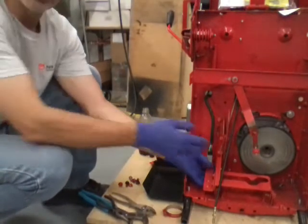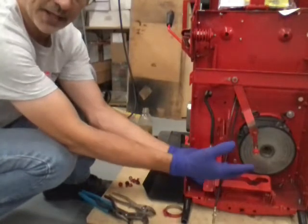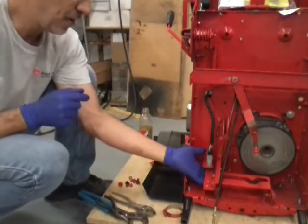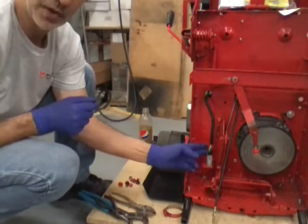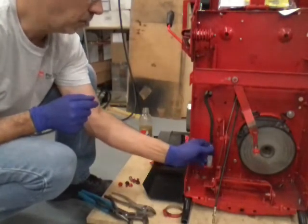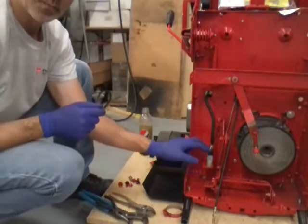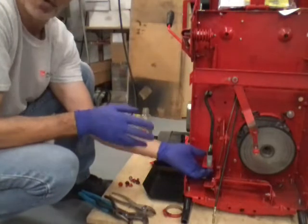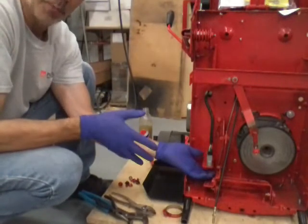This is your yoke. When you push your clutch in, this comes up and pulls the chain case away from the drive disc. If you push it up hard enough it applies the brake. This little gray thing is a safety switch, and when you're letting out your clutch it opens the switch up. This switch isn't just an on/off switch — it has four wires coming out of it, meaning it's both normally open and normally closed.